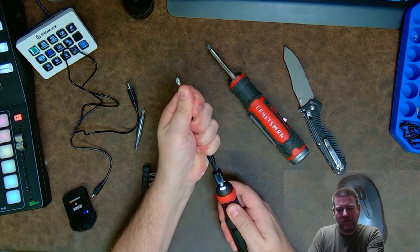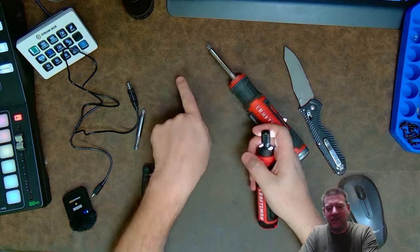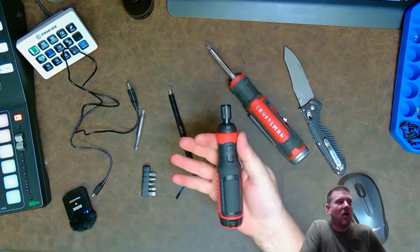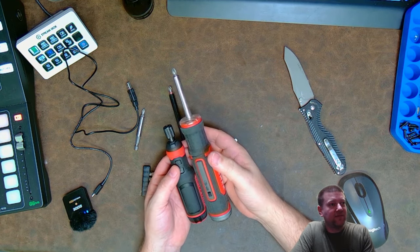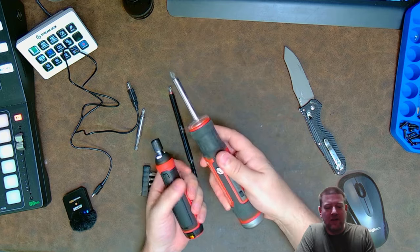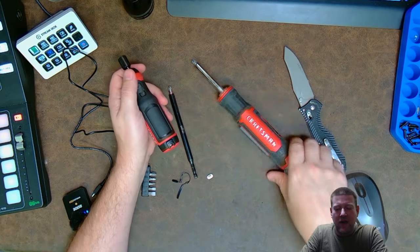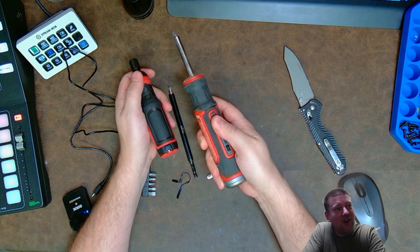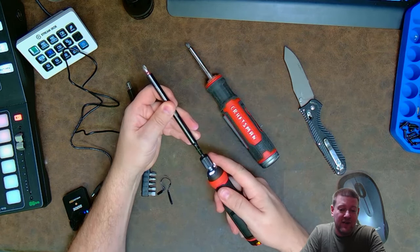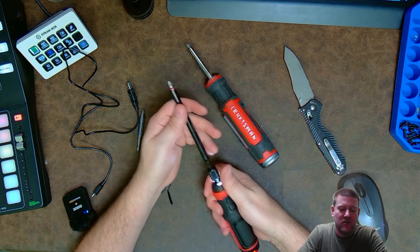Take a look — two push buttons, folks. The grip is extremely comfortable and it's almost as compact as a screwdriver can get. They both operate on four volt lithiums, but this one has gyro motion and the new one has two buttons. The buttons are a little more intuitive than the gyro. The gyro allows you to rotate very quickly, but sometimes inside a piece of equipment you can't rotate the body in the direction you need. With buttons and a secured chuck, I can use extensions without being afraid of the bit falling off — very intuitive.